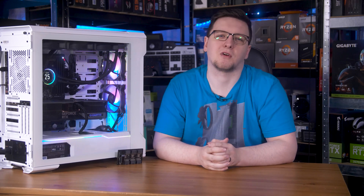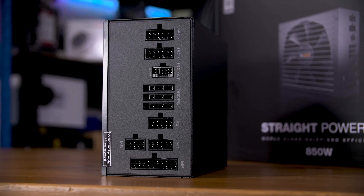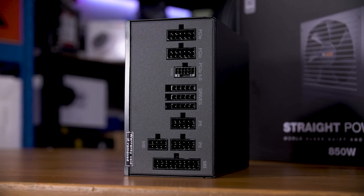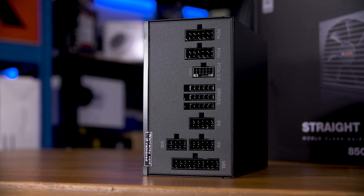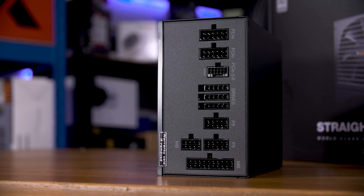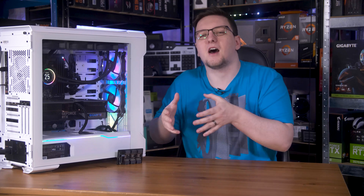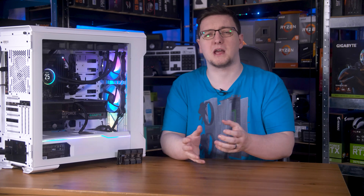As a final piece of advice — especially if you're building from scratch — it's worth getting the best quality power supply you can and oversizing the wattage a fair bit. Your power supply is connected to every single component in your system, and low-quality power supplies can literally destroy your system. When you inevitably want to upgrade later, having an oversized power supply will make that upgrade easier, and it's well worth the often relatively small extra cost up front.